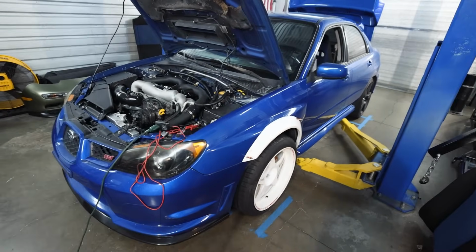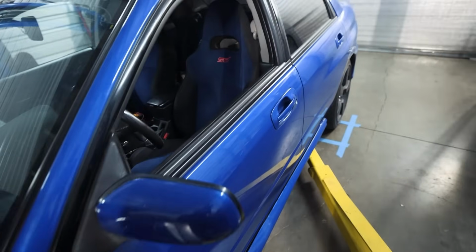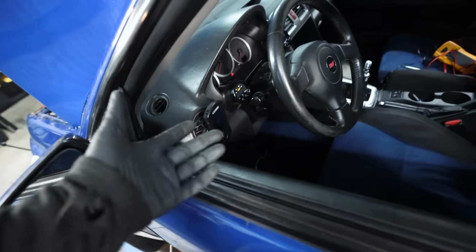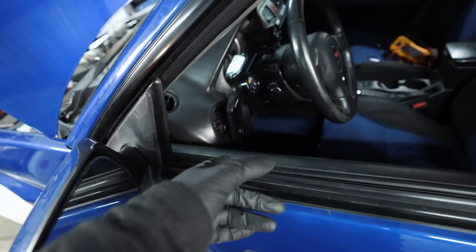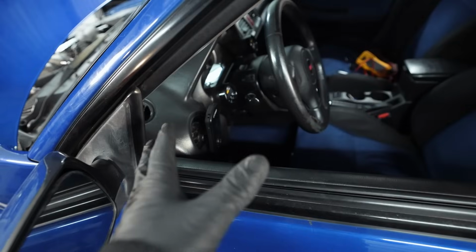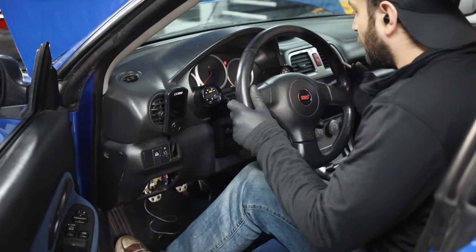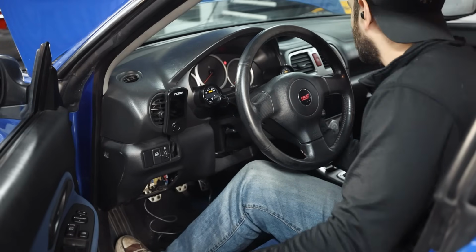But before we do that, I am gonna go ahead and marry our Access Port. If you don't know how to marry an Access Port, super easy. You just go on the Access Port, you hit install, it'll walk you through the prompts. There should be green test connectors on this car, which sucks. I'll put those on a switch later. I'm not too worried about it right now, so for now, I'll just crawl under the dash, plug them in, unplug them. Once we get the Access Port all married up, we can go ahead and marry our key fob.